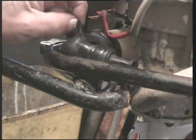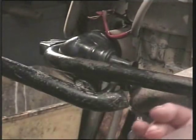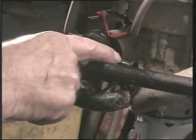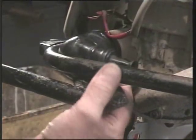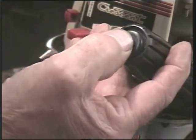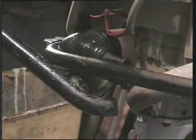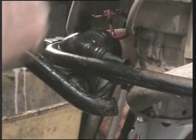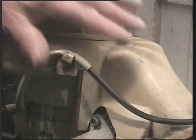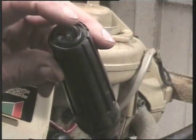And I've had a look at this nasty taped up inlet, which is above the exhaust here, so I suppose that warms that. But there's some more tape here and there's some cables. And I've suddenly realised at the end of there's a push button kill, and you can feel it, to kill the ignition. So if that's gone short, or there's something funny here, that could very well be the reason we haven't got a spark. So I'll investigate that before I decide to take off all the flywheel and investigate that. So let's eliminate this button.